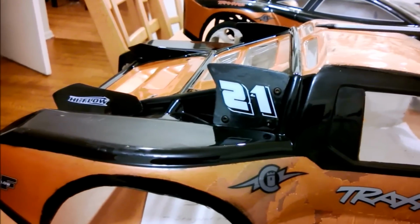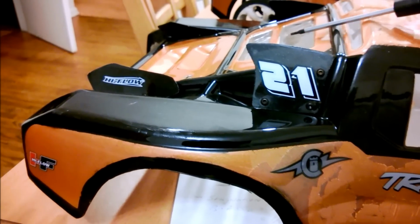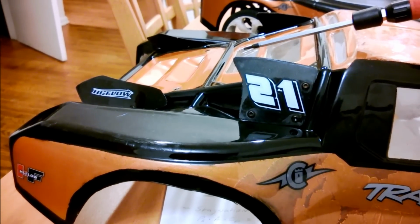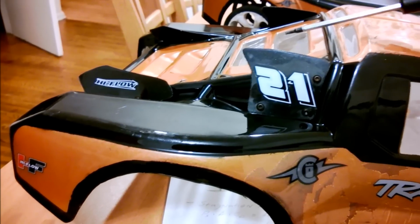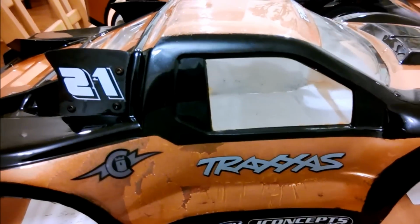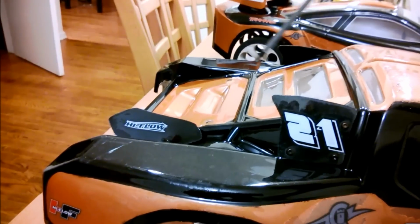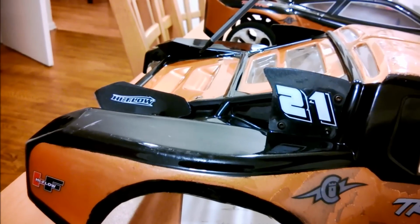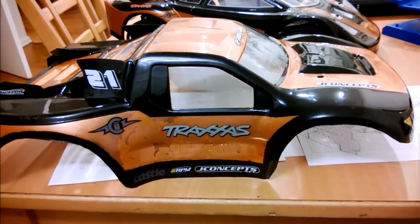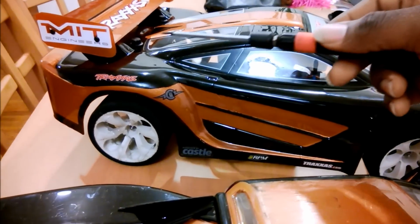Going over to the body here, you have a sudden drop off of the body, and you can see that this isn't a standard pickup truck shape, so they put this aerodynamic shell on to try to make the air flow easier over it. But still, you've got a high pickup and low, and then a big drop off. That's going to create a big area of suction on the back here, and that acts like a parachute. So this shape is not going to be as aerodynamically efficient as this shape, which has more subtle changes and is smoother.